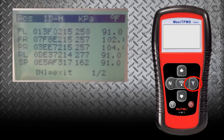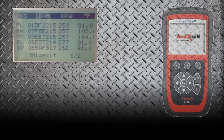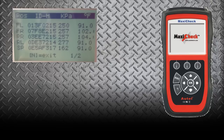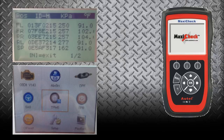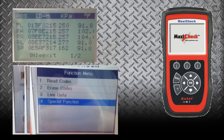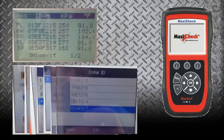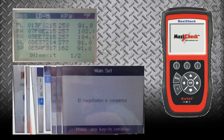You will need to utilize a professional-level scan tool or another scan tool set up specifically for programming TPMS to the PCM. In this particular case, we're going to use the Autel MaxiCheck Pro, which has the ability to program the TPMS sensor IDs directly to the PCM. We have all the sensor IDs on the left-hand side of the screen. We go into the MaxiCheck Pro, select TPMS, select the vehicle — Asian, Toyota — then select Special Functions. Special Functions gives us the ability to do ID registration, which takes the sensor IDs and registers them to the PCM. We click Edit, add all the sensor IDs, click Finish, and it programs them to the PCM and confirms it's complete.